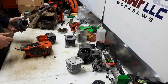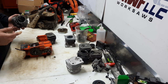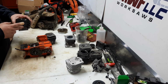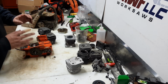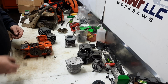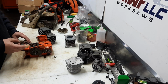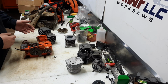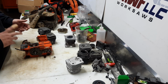But if we have to sleeve it to get where we need to, I guess we could do an aluminum sleeve, chop the head and have that plated, because we can still get them plated if the heads are off, if it's an open bore. Or we can get another 36 millimeter stroke and use a 48 millimeter bore. That'll give us 4 cube as well. And there's lots of 48 millimeter options.